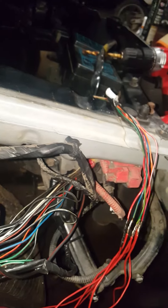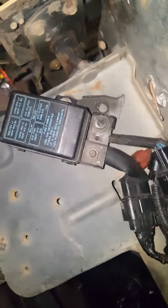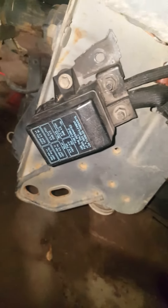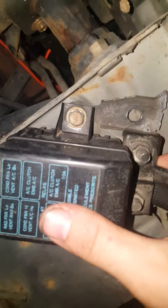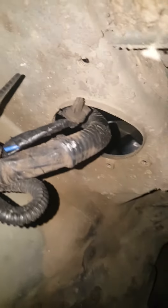I'm not going all out on this wire tuck — if I were, the fuse box would already be moved. I'm just showing people there's a simpler alternative. Usually your AC stuff is right up here; just moving it right down here keeps it clean and out of the way. I do highly advise making sure there's some type of weather-resistant seal between the cover and the box itself. I had to cut this bracket, which I'll end up remaking, but where this bolt is there should already be a threaded hole.